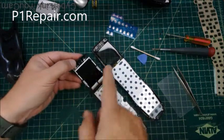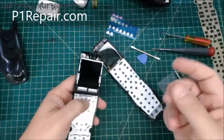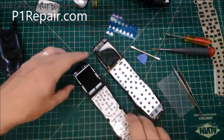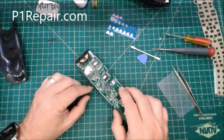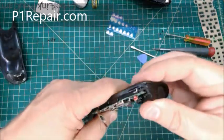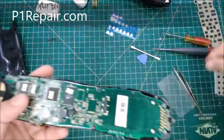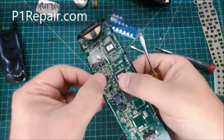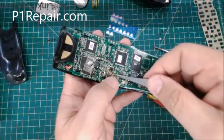And, okay, so now there's dust on the screen. You can lightly brush it off. If you have a can of compressed air, you can blow it off. Or you might want to clean that off too. Okay. And to put this back together, now I'm just going to flip this over. There we go. And wiggle it around so it all falls in place. And then we need to plug in the touch screen again, and that little hinge door fell down, so I'm going to gently flip it up and put this in there. Again, tweezers might help you out here.